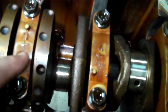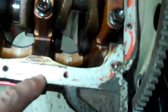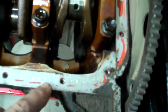So I'm going to look at my chart. 3 B is yellow, so it should have a yellow mark on it when I take it out. The next one is 2, and all the rest are 2s — so that's 2 A, 2 A, 2 A. All the rest are 2 A, and back in my chart, 2 A is black. So my main bearings: I need a colorless, a yellow, a black, black, black. The corresponding sizes to the colors are right here on this chart.